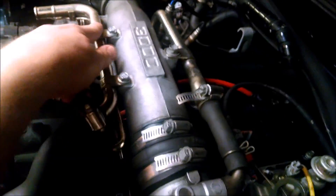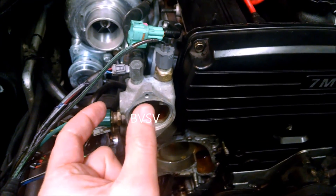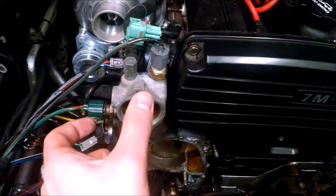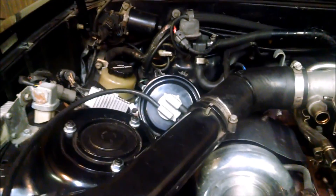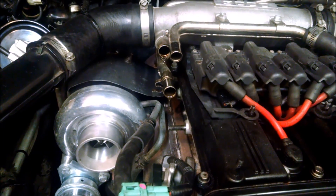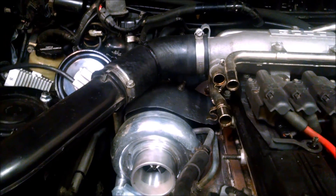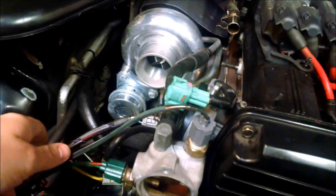This routing goes here through the pipe work and then normally you would come out here to your water outlet. And there's the BVSV — bimetal vacuum switching valve — and that will switch your vacuum on and off to your charcoal canister. If you don't have a charcoal canister, there's not really any purpose for that system. So if you're out in rural Iowa, chances are your legal situation may not require that. But if you have a charcoal canister, that's how it should be plumbed. If you don't have a charcoal canister, then you don't need that.